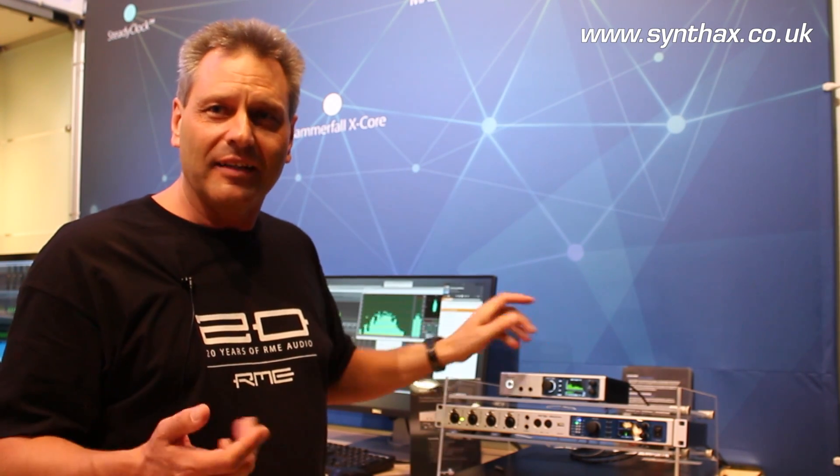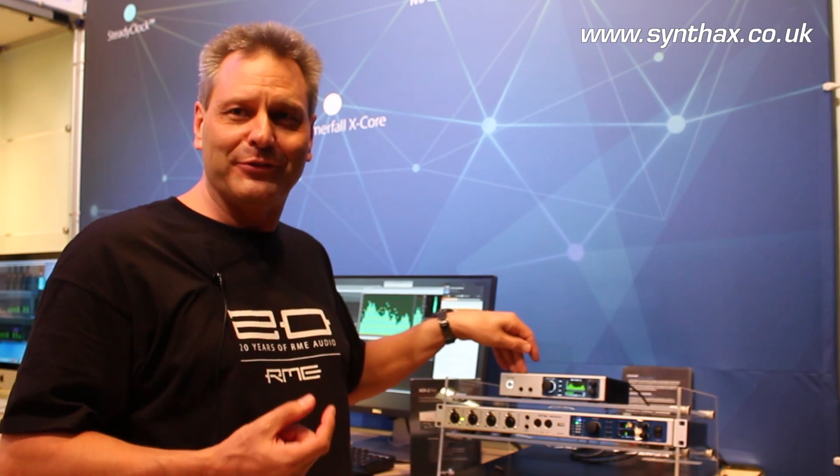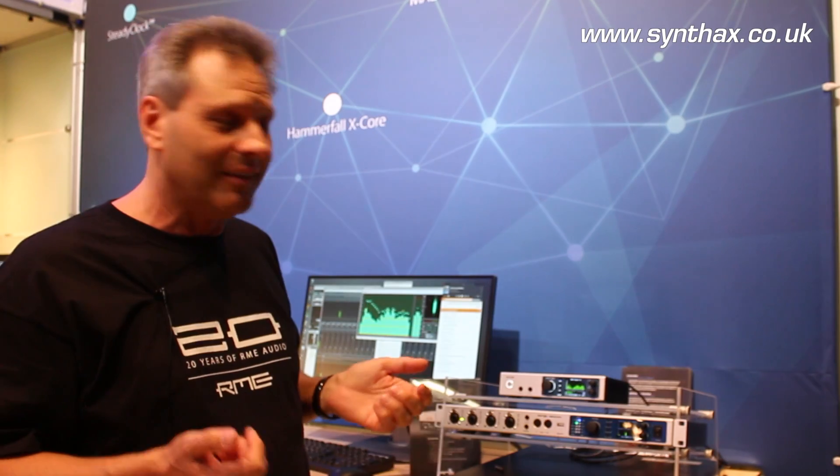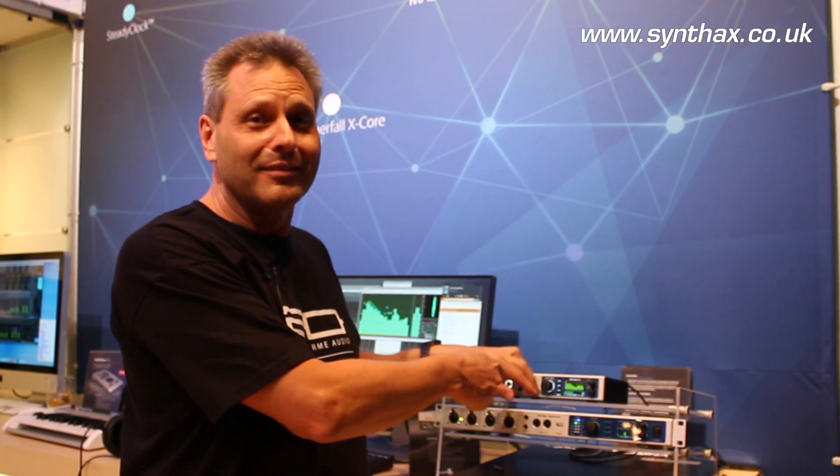This unit comes with a lot of interesting features that make usage very comfortable. For example, when you plug in the headphones, a relay behind it will switch 0.5 seconds later and the DSP will ramp up the volume within two seconds. This provides a luxury feel and also prevents you from blowing your ears, since at 22 dBu and 2 watts you could easily do that with the wrong settings. This unit helps you prevent that.